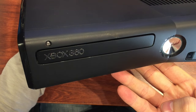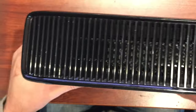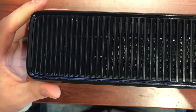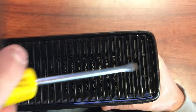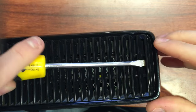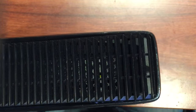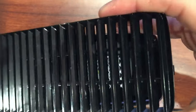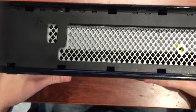If you look at your Xbox, look at the front and just look at the top left-hand edge first. We just basically grab a screwdriver and just lift up this plastic at one end. It's quite easy to do. Once you get that started, the whole edge will come out. This is really flexible plastic, so it doesn't break too easily, which is good.